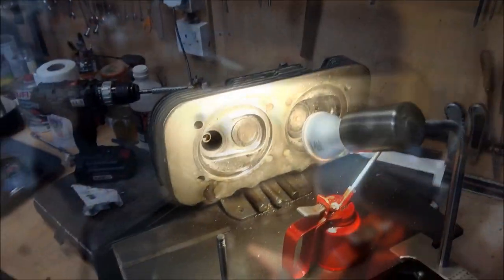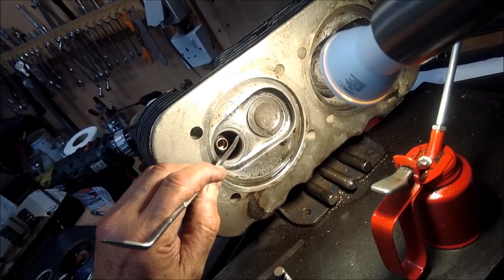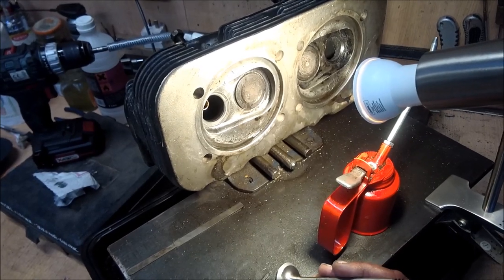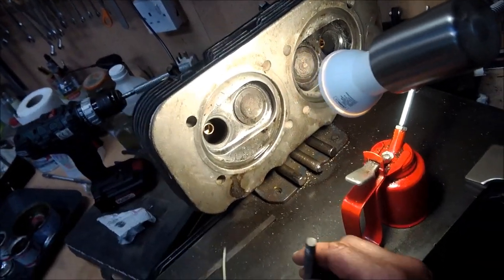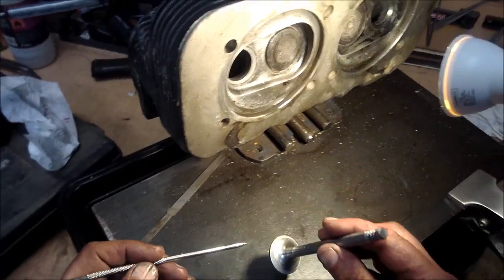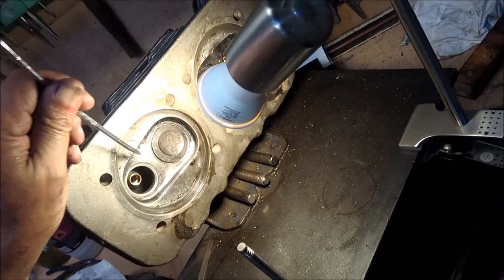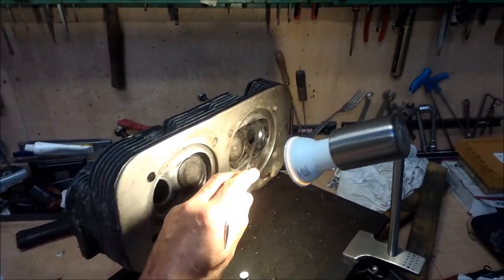We've done some more grinding, still on the coarse paste. The seat is starting to come together but there's still a little bit of a shadow - it was a bit reflective before, so we've got to keep going a little bit more to chase that out. Here's the valve itself looking a nice wide seat - it'll have to be done with fine paste to take out the scratches. On the rough grind I'm quite happy with that - tiny trace of shadow but that will come out with the fine paste. This one took six passes versus three for the other one.